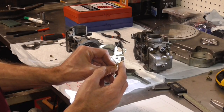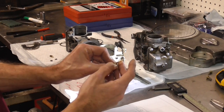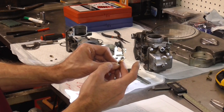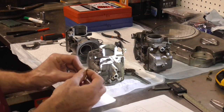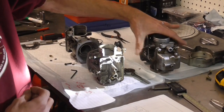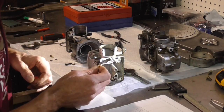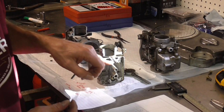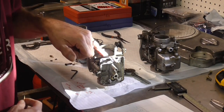This part right here is a taper, and the very end of it is a taper as well, because it controls how much air and how much fuel go together. To figure out the most important pieces, I took a carburetor — a good one that was busted up, looked like an aluminum-eating beaver got a hold of it — and I sectioned it off so I could see what's going on inside.